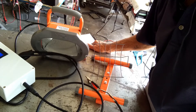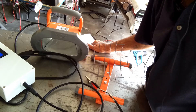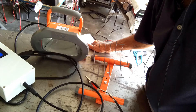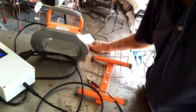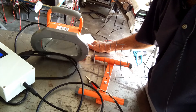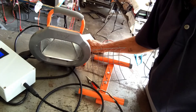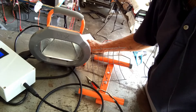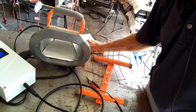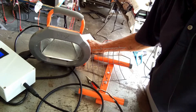So that's the discharger. It discharges the whole battery pack in one go in most cases, like Hondas. For Toyotas you may have to do half a battery at a time. For bigger vehicles like the Camry, Yukon, and Ford Escape, you can do it in two halves or even three parts. If the battery gets a little hot — which I don't expect with the 600-watt light — wait at least half an hour before you start charging. Let me know what you think, put your comments below, and like and subscribe to our channel.